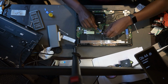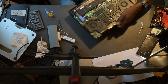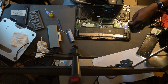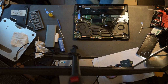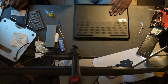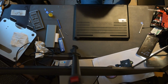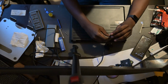And if your laptop comes with that, again, just make sure you do it well. Finally, that's the LAN cable that sort of runs over the heatsink and makes its way to the back where the LAN port is, and then you just return the casing over the laptop and replace all the screws exactly as they came out. Again, this is purely for the fact that they come in different lengths, so you don't want to be misplacing the screws and end up potentially damaging the system.